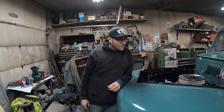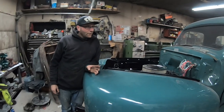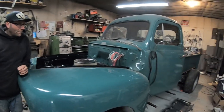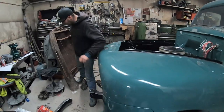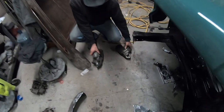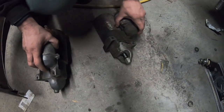Okay guys, Chris and I are back working on Kevin's truck. They've just gone to my place to grab the rear fender so we're going to install them in this video. Last week we were going to try to get the motor turning over but the block takes a staggered starter - I just had a regular one - so I'm hoping this starter is going to work.